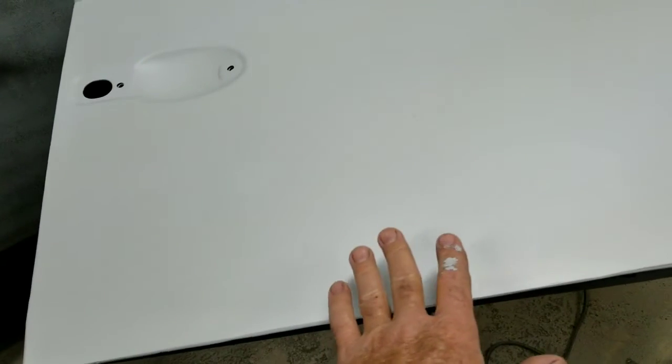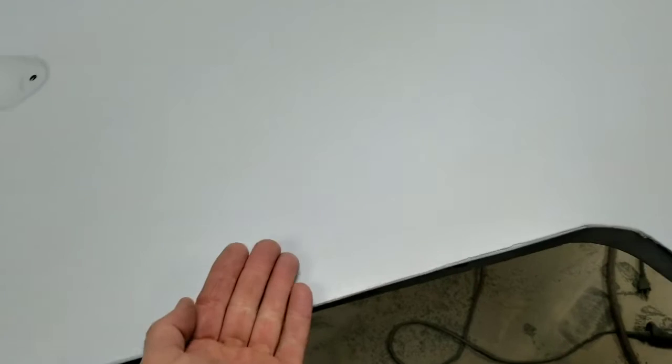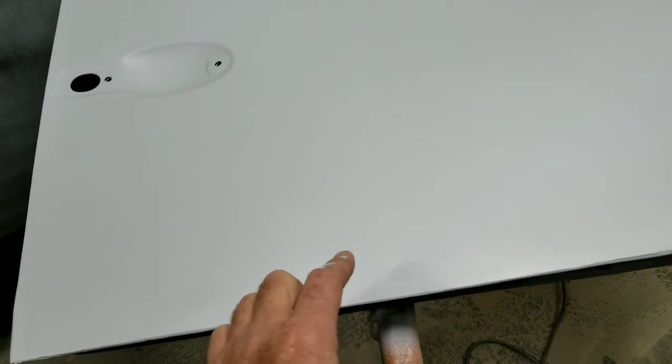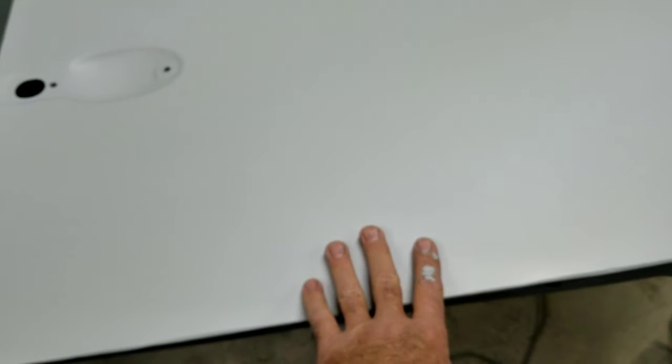Okay, and mine was just basically when you cut away the old panel, it just kind of lifts up on its own. So when I welded, I started in the middle. I tried to push it down evenly across, very gently, and spot weld it. And the Harbor Freight welder, which is really cool, doesn't get it really hot. So it wasn't warped because of the heat. It was warped because of right where I pushed it down in the first place.